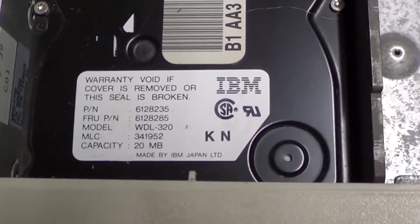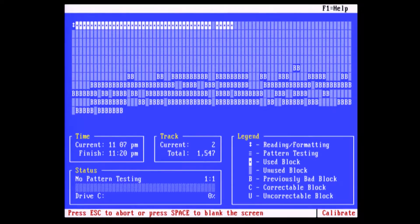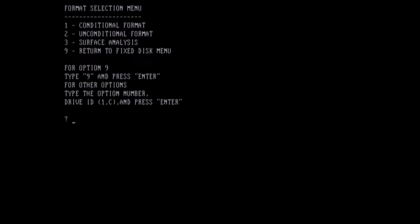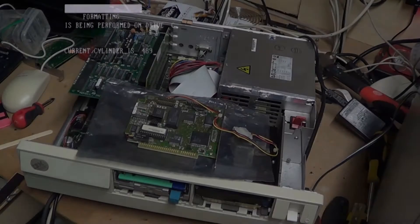The next problem was I went to install software and started having general failures. It didn't take me too long to see what the problem was — the main hard drive had megabytes of bad sectors. It was absolutely ludicrous and the drive was just unusable. With most drives of this style and capacity, a low-level format is often what's called for, so I used IBM's utility to do this. Unfortunately, I get the feeling the drive was just faking the low-level format, because it did absolutely nothing for the reliability. Even after a fresh DOS install and format it just kept misbehaving. I'll look at the drive at a later date — for the meantime, we're going to go with an aftermarket solution.